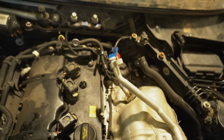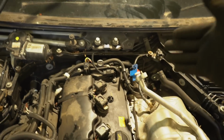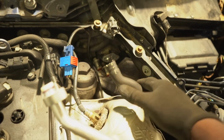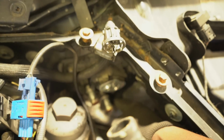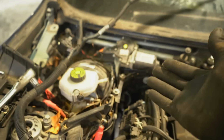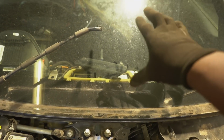So guys, I've just noticed something. All along, I was saying that I need to drop the engine to be able to remove that unit there because there's hidden bolts. That's because when I've done this job before on the B58, when I pulled the B58, it is such a beast of an engine, there was no space to access the nuts and bolts. But as I'm working to get these 2 hoses off, so these are the 2 connectors that I was working on down in there, I've got access to the nuts that I need. Look, 1 and 2, and that's going to hold that heater matrix in place. And on this side, you've got one big nut right there. Don't know if you can see that. Yeah, right there. So I have got access. So what I'll do now is take those nuts off and try to take that heater matrix unit complete, so I can continue removing all the wires on the inside of the car.